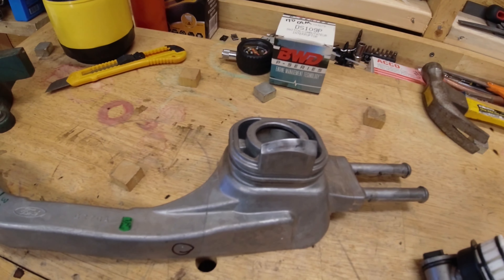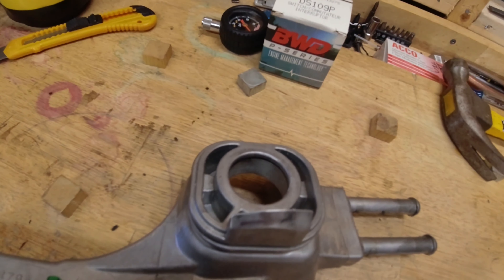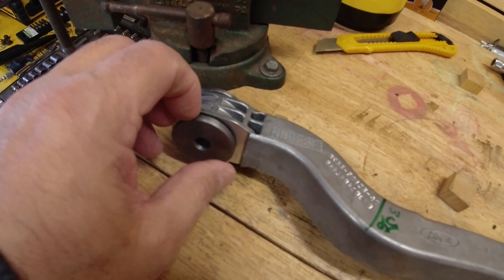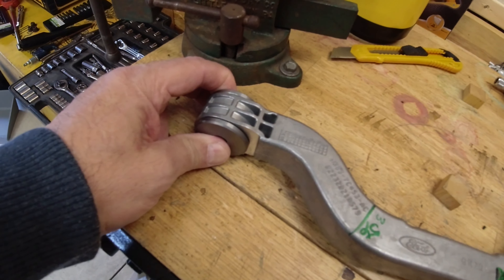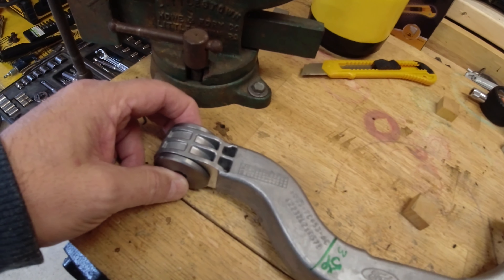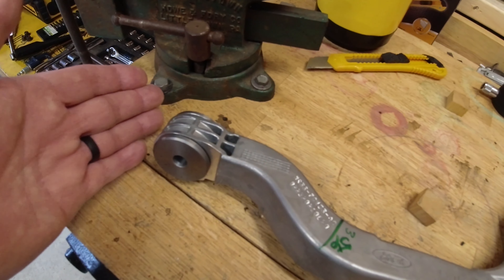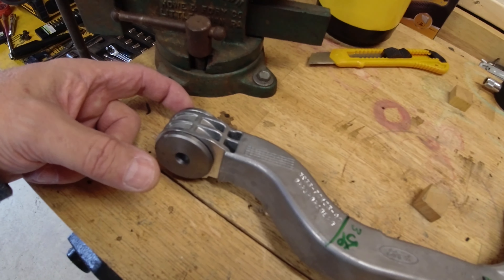This is the support piece for the Ford shifter. There's a rubber bushing back there that those two prongs go into. That section is where your shifter actually sits, and this piece up here has two steel bushings with rubber gaskets on the inside — this is what actually bolts to the transmission. That's the bolt that's difficult to get at. It's bolted through on the passenger side, goes through the top of the transmission. There's an aluminum bracket up there that it goes down into. You have to unscrew it from the passenger side, and that's the difficult part. It's a really long bolt and it takes a long time to get at.